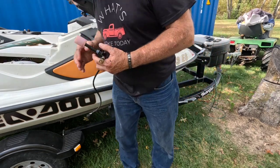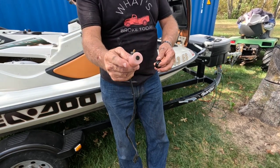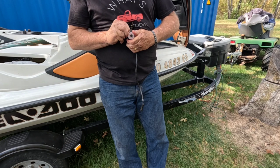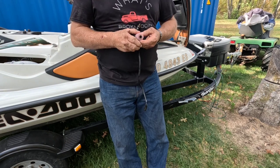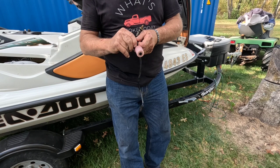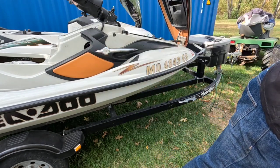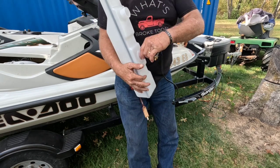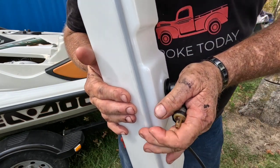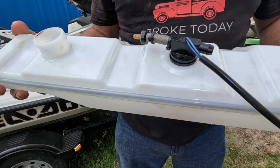For our level sensor, where the sensor is at the bottom it's a little bigger, so I actually put the grommet up over that — sometimes easier said than done. I put lots of oil on the grommet, put the sensor down in the tank, put the grommet in the tank, then just gently push and twist, and that will pop down in the tank. Now we're ready to go back in.